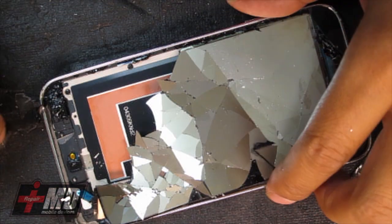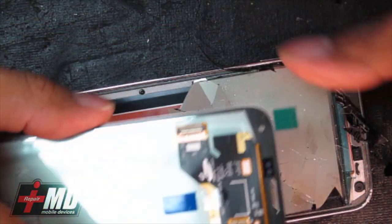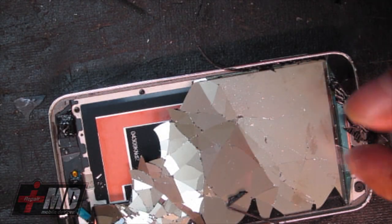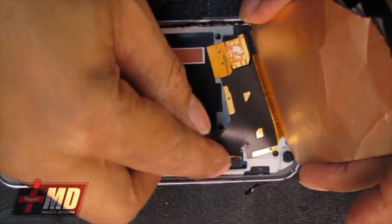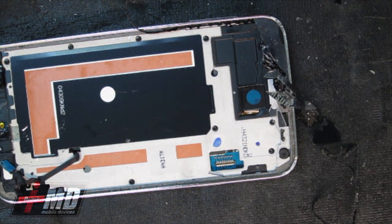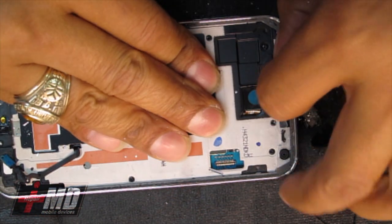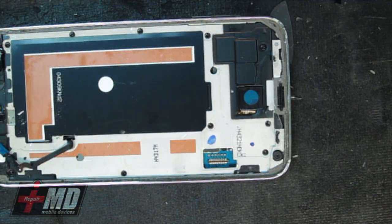As with any new device you're repairing, if you don't know what's underneath, just be very careful as you're taking it apart. The way I see it, the only thing you have to be sensitive about is the cable attached to this part — everything else is behind the phone. The LCD and digitizer connector can be detached by pulling it. You don't need to access the back at all in this repair — it's all front assembly. So if you have a cracked screen and LCD, it's a fairly quick repair, probably takes less than five minutes once you get the hang of it.